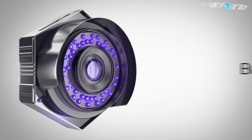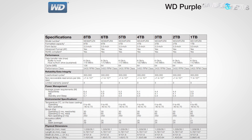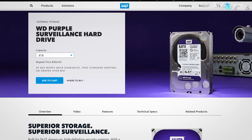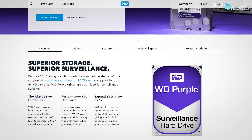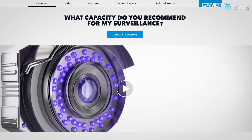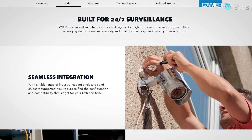That leaves WD Purple, the one meant for surveillance and the least popular. As a surveillance drive, it's going to be running writes pretty much nonstop — it doesn't have much other purpose than running writes for whatever camera system it's configured to work with. That means mostly steady-state run times, and as such, there's custom firmware and caching built to handle those nonstop writes. WD Purple drives have an annualized workload of 180TB per year, backed by a three-year warranty. Because these drives write nonstop and overwrite footage as they go, this rating is critical for nearly 100% uptimes for security purposes. The drives also use WD's all-frame technology, which theoretically reduces pixelation and frame loss in video capture. TLER and ATA streaming command sets are also supported in WD Purple drives.